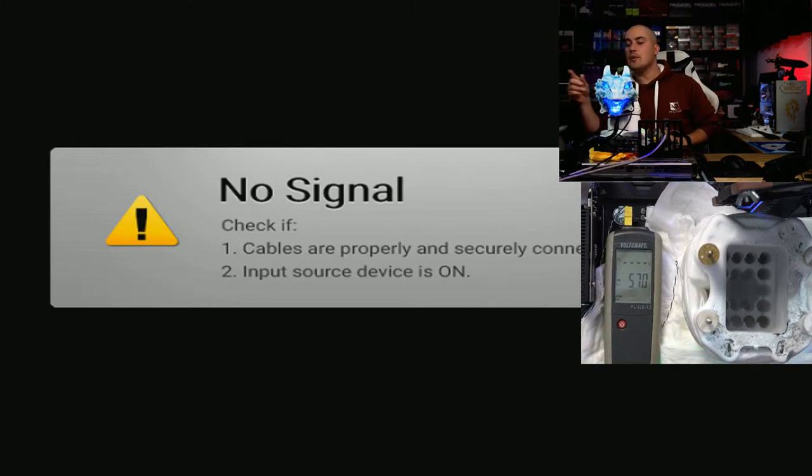I really hate this. Anyway, what did you miss? Did you miss that we were at like 1600 megahertz FCLK, negative 180, and the system restart? So it's not as strong as I want, but we can lower a bit the frequency in case we cannot go past it. Sometimes you can tweak the voltage all you want, but if the chip is nasty, it's nasty. And the only way is to reduce the FCLK and play with the frequency, but we will see.